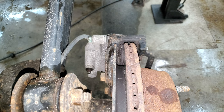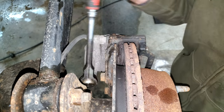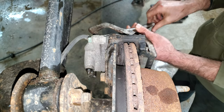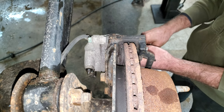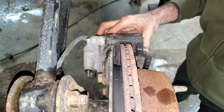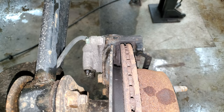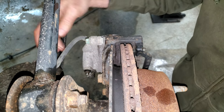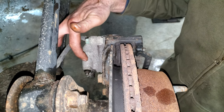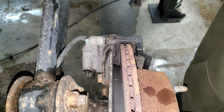On the rears there are no big holes in the calipers, so I'll go about it a different way. I'll loosen the bleeder and use a C-clamp to squish the caliper down. This caliper feels really nice too — slides well and the piston went in nicely, so I won't need to replace it. By the way, these bleeder screws are supposed to be torqued to about 106 inch-pounds. I like doing them by hand because you can actually feel when the taper hits and know it's seated, but use your own discretion — either it'll leak or it won't.